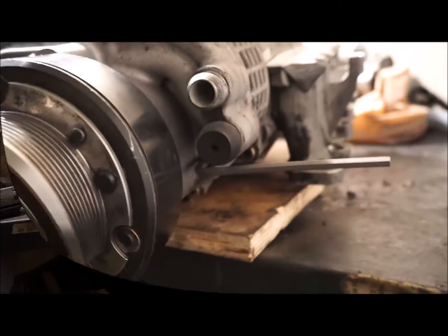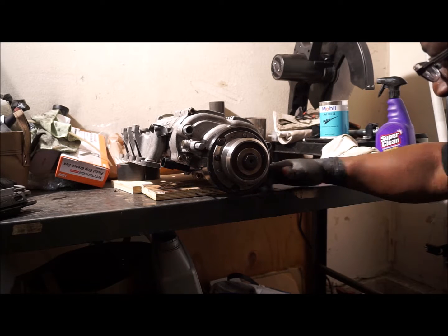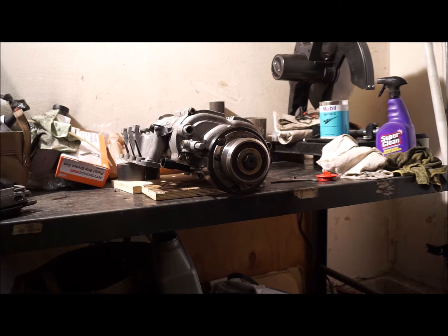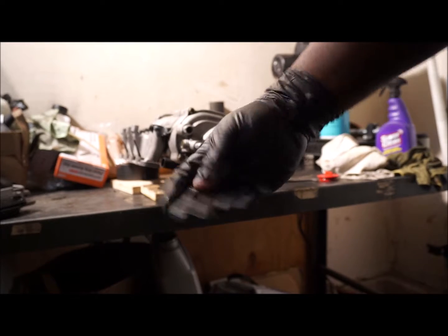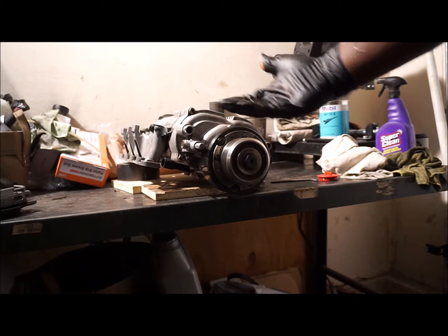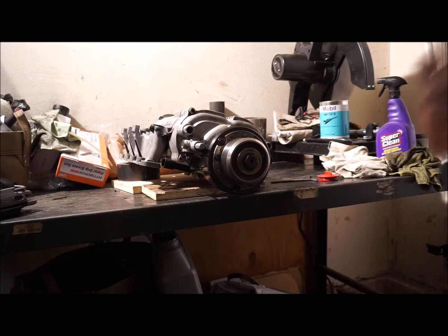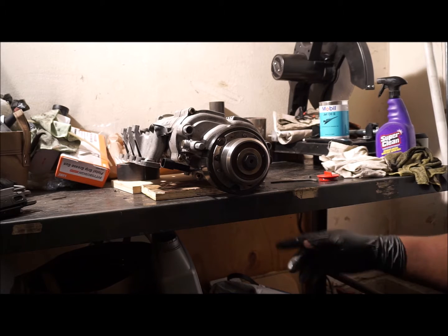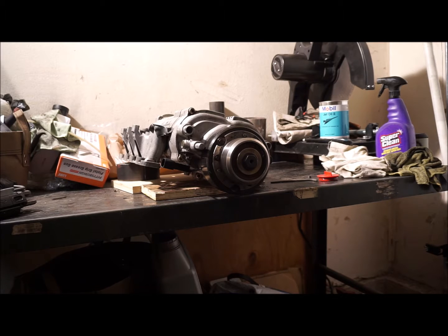For those watching at home, yes it does smell like a barn - the old oil really reeks. It kind of dripped and splattered out. It comes out very dark brown, almost black. I got the Allen hex socket off - 4.5 millimeters. I loosened it and it came out. Make sure it doesn't fall to the bottom of your oil container. Be ready to catch it - this will be a slow trickle. Most importantly, don't lose that hex screw. You can find them online but I've seen one guy selling them for $10-12 a pop.